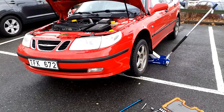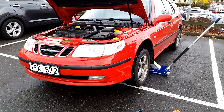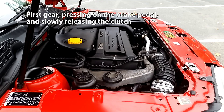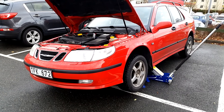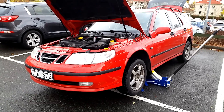I'm having some trouble with excessive engine movement, and it seems like I have a torque rod bushing that is worn out. Take a look at this video clip to see some excessive engine movement. Changing the torque rod bushing is supposed to be quite an easy job — I've never done it before, but let's go ahead and jump into it together.